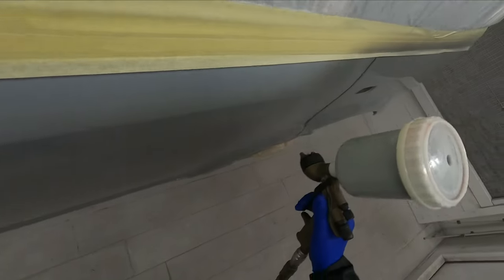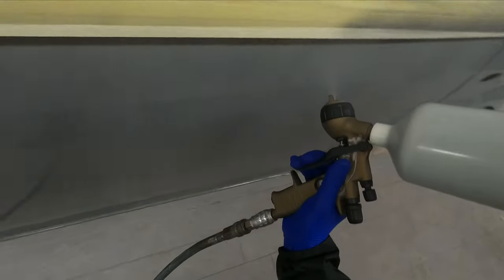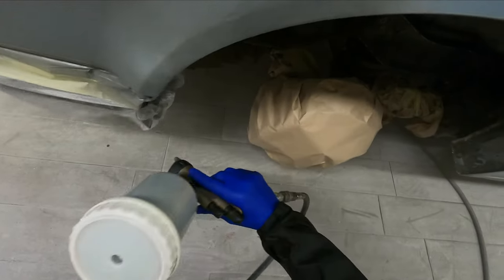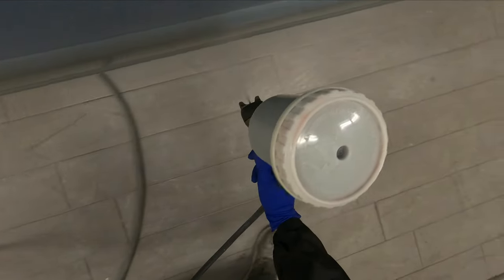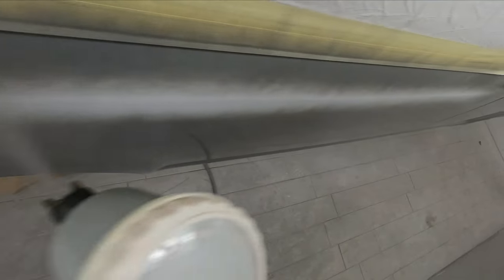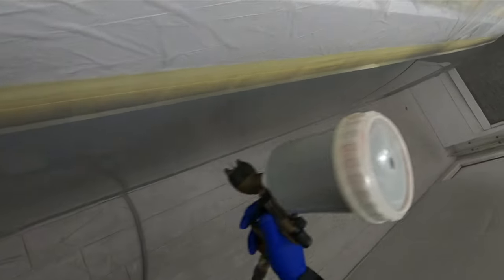In part two we'll take over from the bottom end and move over to the masking and then the top end part of the job. You can see as I'm going up there, where we put that slight soft edge along with that masking tape, I'm just angling the gun underneath that to start off with to make sure I get right underneath that gap and paint where I need to in order to fine line that off in the future. We're running about a 50% overlap, not running too much fluid — probably around about 2 turns out on the gun — just taking this first coat nice and slow and careful for a nice even coverage.